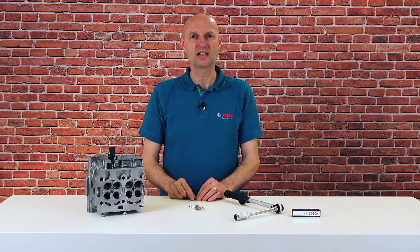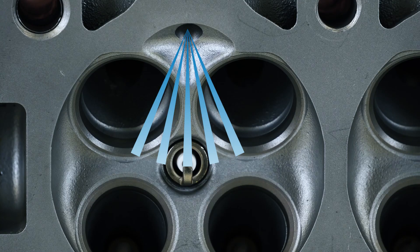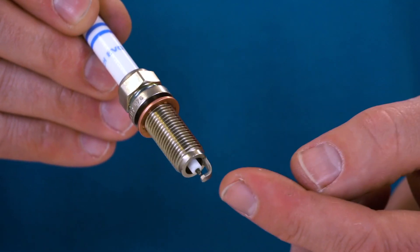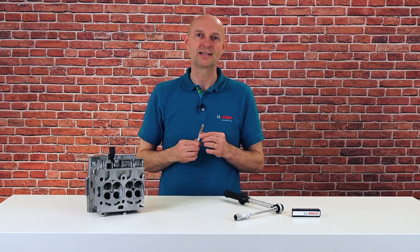For this reason, the electrodes of the spark plug must be positioned exactly in the area of the ignitable mixture. It is crucial that the air-fuel mix reaches the gap between the electrodes unhindered, so the ground electrode needs to be positioned correctly. Bosch developed special spark plugs for GDI engines. This Bosch EVO spark plug is equipped with an oriented ground electrode and a solid seal ring, ensuring the spark plug arrives at the right position and installation depth in the combustion chamber.